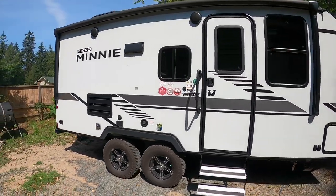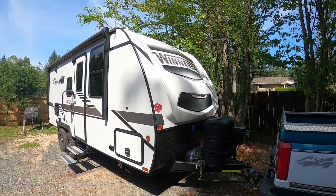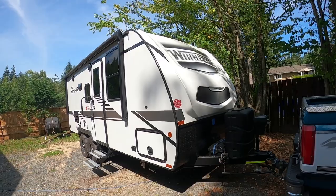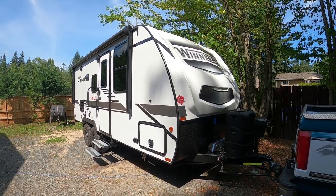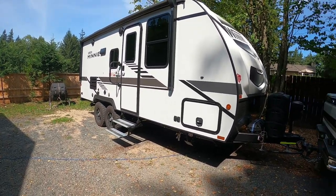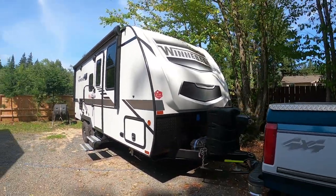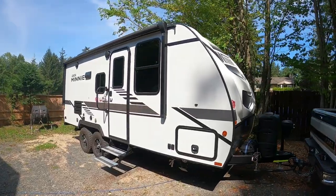If you can buy one of these and get it inspected first — get someone to fix all the problems before you buy it — I think you'd have a pretty darn good trailer. I just had it at the dealer to get the water heater fixed; it's been blowing the thermal breaker due to backfiring, and most recently even a slight breeze would blow the flame out causing it to cycle repeatedly. I'm hoping they got that fixed now. Still hoping to get a fridge door handle one day — if I can't, I'll find one on Amazon or just make one. Thanks for watching.